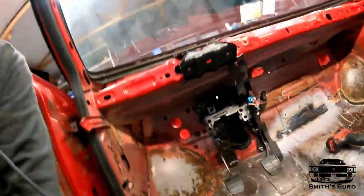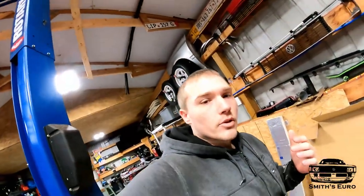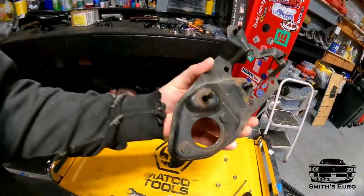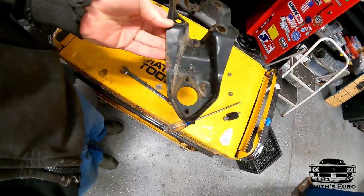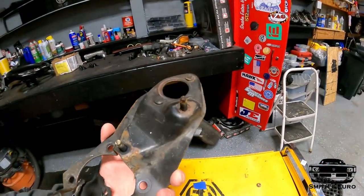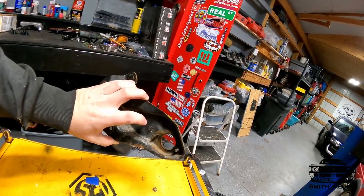Once this is completely flush in place we can get the clutch pedal bracket assembly that goes on the front, because that's where you get your attachment point for your clutch master. This is on Corrados and all G60s — so if you have a Corrado G60 or a Passat G60 you have this attachment point and this is what we need. You can't get this off hydraulic ABS cars because it's a different setup. We'll need to drill one, maybe two holes in it because it's going to sit against the firewall.